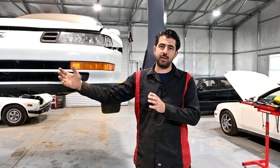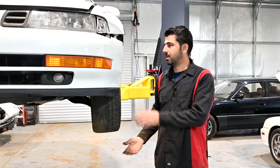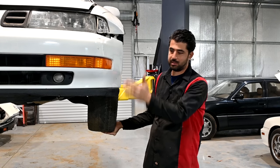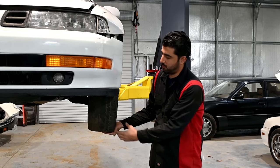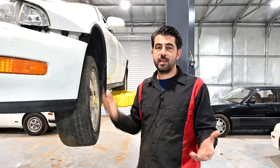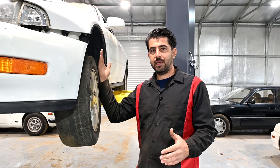As I explained in my previous video on caster angle, when you make a sharp right turn, you're going to experience body roll. The weight of the vehicle gets transferred to the outside wheel — which is your left wheel as you make that right turn. With neutral camber, that neutral camber in effect will turn into positive camber where the top of the wheel is tilted outwards. When you have positive camber going around that sharp right turn, your contact patch is going to be the outside of the tire, giving you less traction and therefore poor handling around corners.